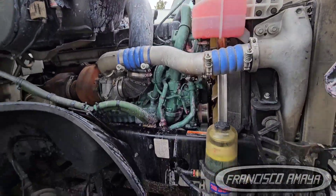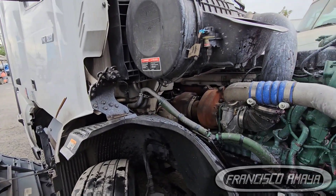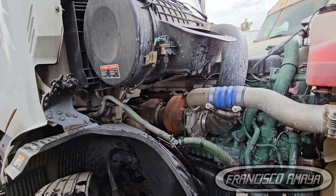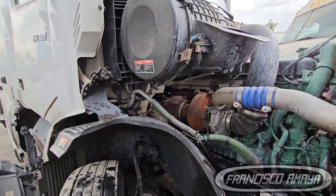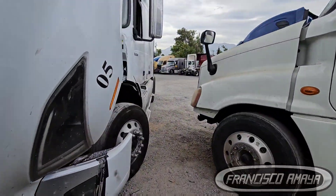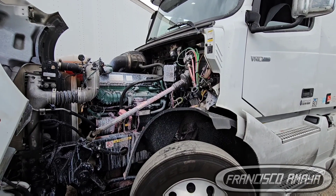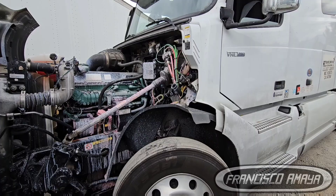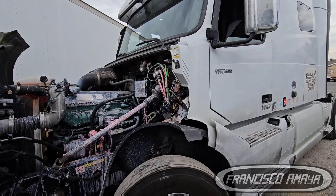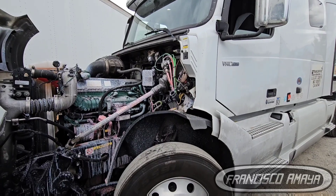These sensors are very expensive from the factory — you can look for aftermarket options but it's still expensive. To do this repair, remove both sensors, do the regen, and the lights should go away by themselves. If they don't, you can clear them. If the lights still don't go away after clearing, you have a different problem — double-check everything to find the root cause.